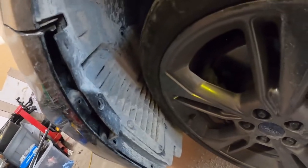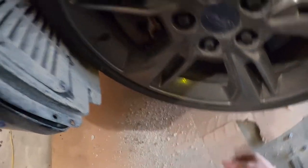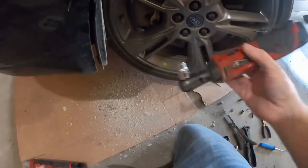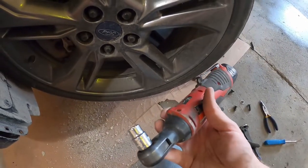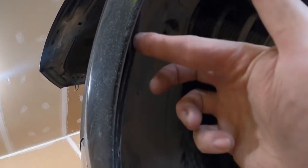Once you've gotten those six out, you really don't need to take the top one out either, but I'm just following the instructions. There are two bolts — one right here and one up in there. This is a great place for one of these powered ratchets because it's got a small ratchet on it. I didn't take this liner all the way apart because I don't want to risk bending the inner lip right here, so I only brought it back just a little bit — I'll make sure to pop that back up when I put this all back together.